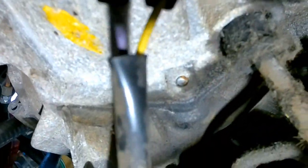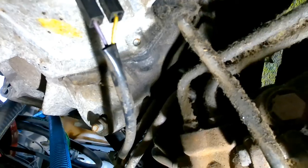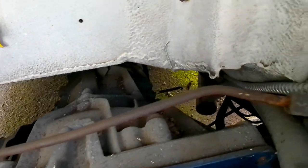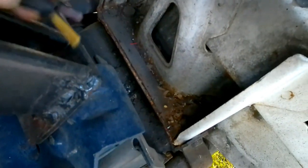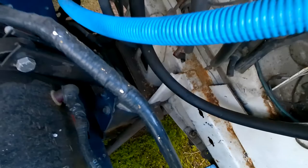The wires are yellow and purple — yellow and purple wires. Let's see where that goes. Alright, we're coming under the hood now. I'm just going down there. That wire, those wires being cut, because this is purple and yellow — that's the one going down to the gearbox. There's the answer there. Just got to find out where it goes.